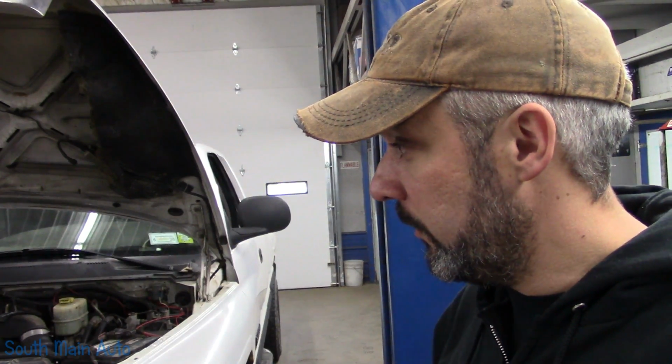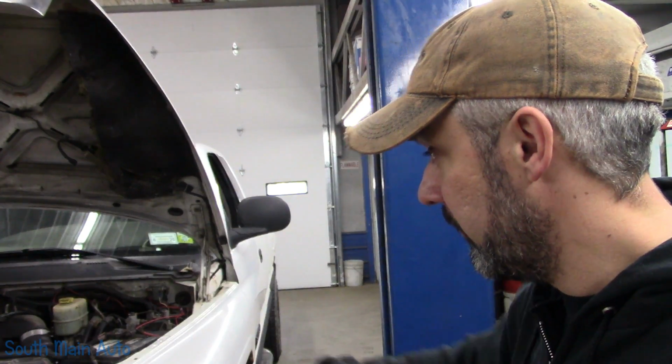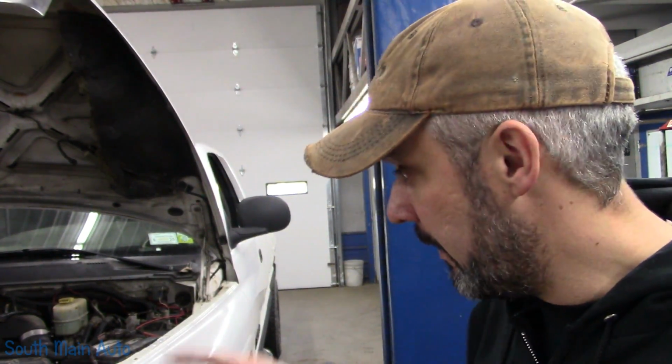So I'll look us up some wire diagrams for that so we got something to go on. We know what fuses are associated with it, stuff like that. Doubt we're going to find a ground in this case, which is typically our MO on Chrysler videos, simply because they're all out, and I believe that they would have all different grounds. Maybe the fronts would be on one, the rears would be on another, but the fact that the cluster's out and all that stuff, probably a power feed issue.